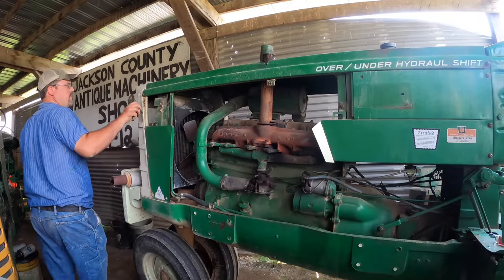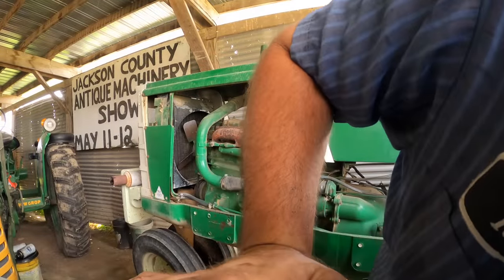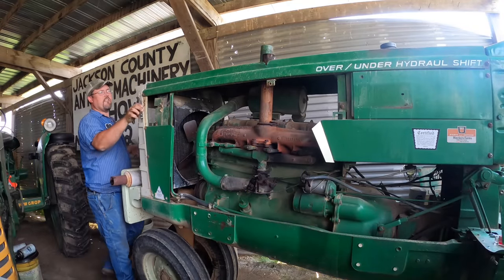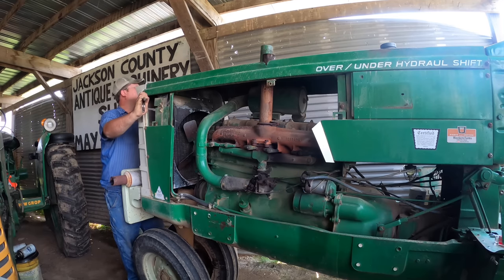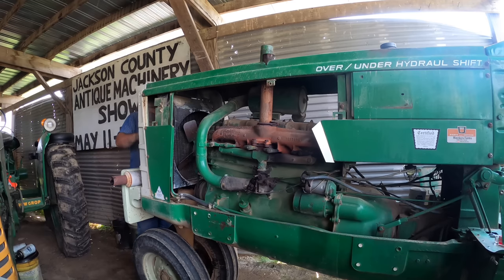The most difficult possible. Now, up here in front, which I better make sure you can see, this is a very official production here, see? These are not just bolts, but in fact, they were a long rod that goes all the way across from one side to the other, which is supposed to provide some type of flex. And it obviously did not work very good because almost every corner of every hood you run across is still cracked out. So obviously there was more flex than even they intended on a lot of them. I've just bolted them solid. It doesn't really probably matter.